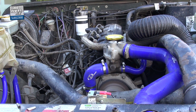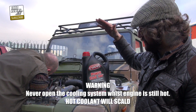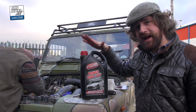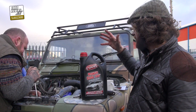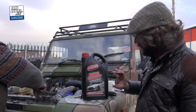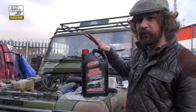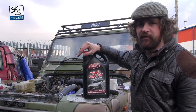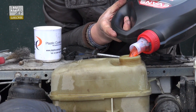We've filled the cooling system with prep fluid and run it up so the engine's nice and hot. Brett's just draining the last of it out and getting us ready to fill up with the PowerCool 180 waterless coolant. With this stuff, we're not going to add any water or any anti-freeze to it. If you had any leaks during that priming phase, just get those cured at this point, because we don't want to be adding water to this afterwards. Evans do also do this stuff in a half-litre or one-litre tub — get some of that just for topping up. Evans do say that in an emergency, if something horrendous happens, you can fill it up with water to get yourself home. So we're going to go ahead and fill this up normally, just as if it were water, and crack on.